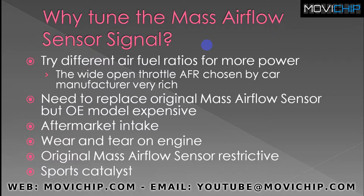For example, the Bosch sensors used on VW, Audi, Seat, and Skoda are usually all the same because there's so much demand and they make so many of them. Maybe there's more than one manufacturer making a sensor, so the prices will be competitive. The VAG sensors can be among the cheapest mass airflow sensors you can buy. So basically, if you can manipulate the signal, you can save money by choosing to use a cheaper, different mass airflow sensor.